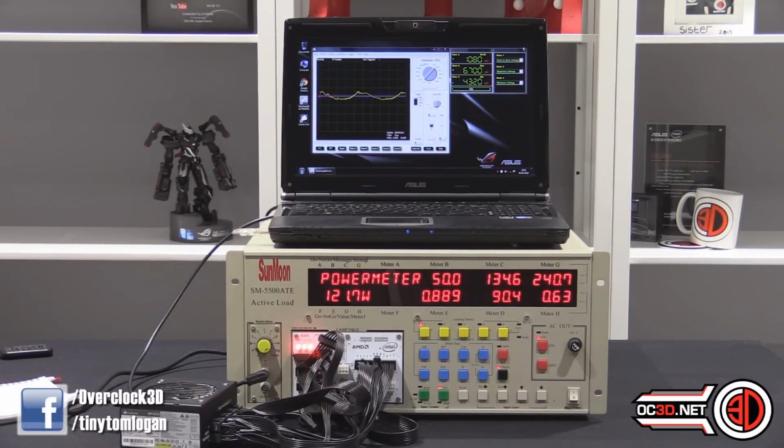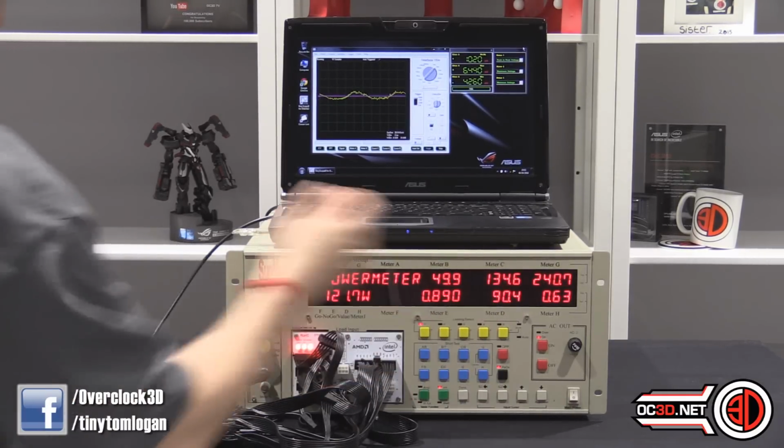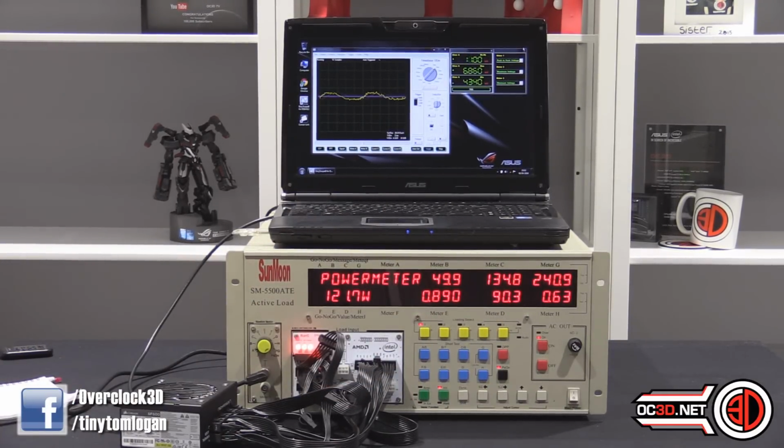So first things first, we are registering on the 20% here at this present moment in time, 90 point, well, it's just gone down to 0.3. When I took my result, it was actually 89.8. So I think as it's warmed up, it has got slightly more efficient. The fan is actually running now as well. Amazingly though, by going over the 90%, that actually makes it pretty much platinum rating. So it's pretty special efficiency when we get there.